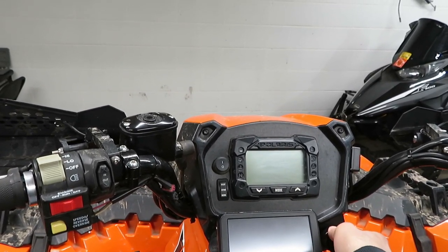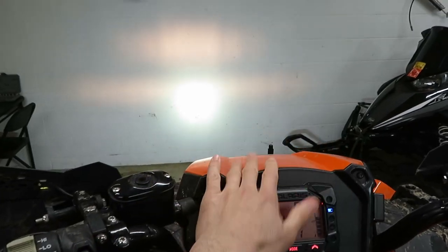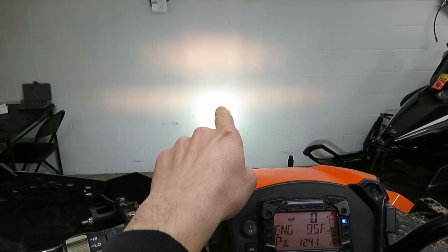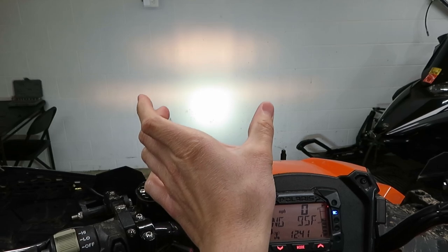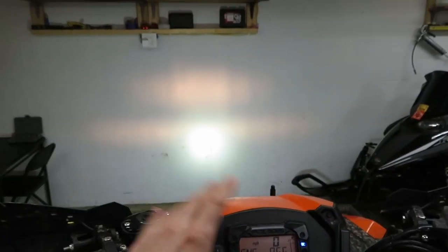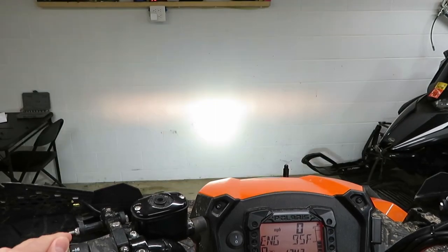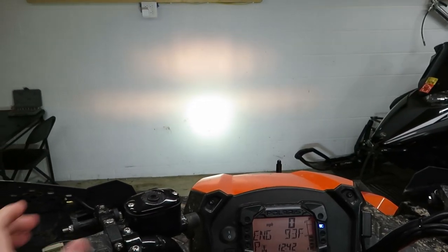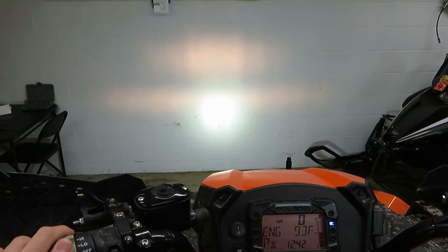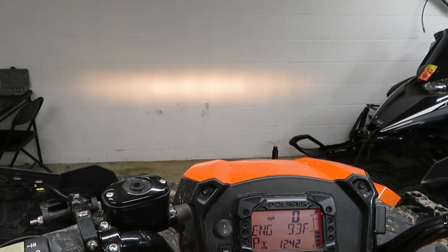So we'll get this turned on and see what this bar does. There's our pitiful low beams. We'll flip it over to high — and we get this light turning on which is kind of the upper section here. There's a really bright hot beam in the center — that's the center portion of the bar, which has a reflector behind those LEDs that shoots the light directly there. And then kind of the whole wall is lit up a bit. When I switch this off you can tell the light drops — that portion is due to the two outer sections of the light bar, which have a different reflector that scatters the light and adds a lot of nice fill. Of course the real test is going to be to get this out on the road.